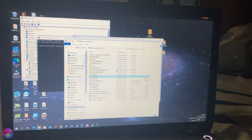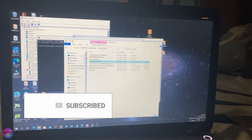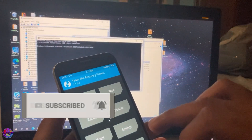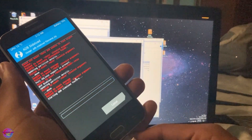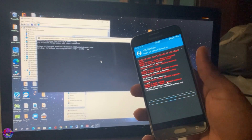That should be here in this folder, so I'm just going to drag and drop. From there, head over to Advanced, then ADB Sideload, and swipe to confirm. Now connect the device and press Enter — it's going to search for the device and send the package.